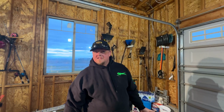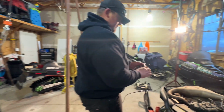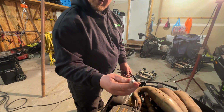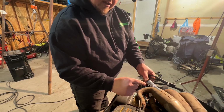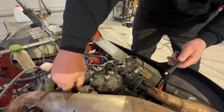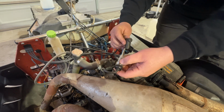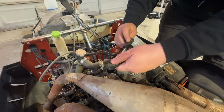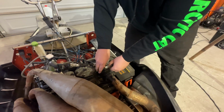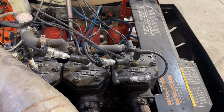You better make sure this thing has some spark. Let me put my spark tester on there. So what these do, these plug on the end of your spark plug. This goes into the spark plug cap. We're gonna kill that light and these should illuminate a color. It's not a very bright light, but it's just like a little amber colored, orangish colored light. At least tell us if this thing has some spark. I'm gonna trust that you guys tell me if you see spark or not.